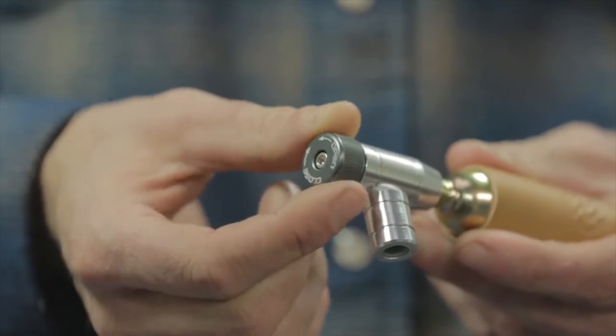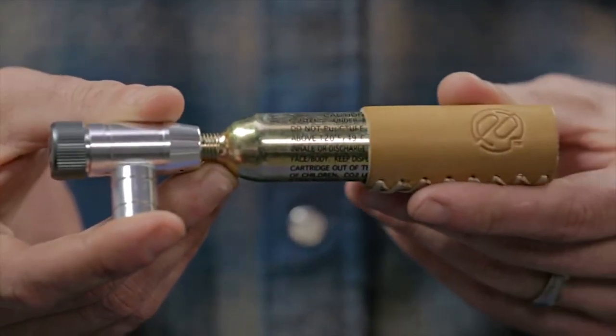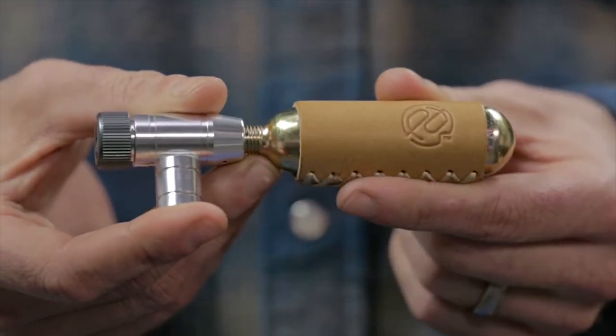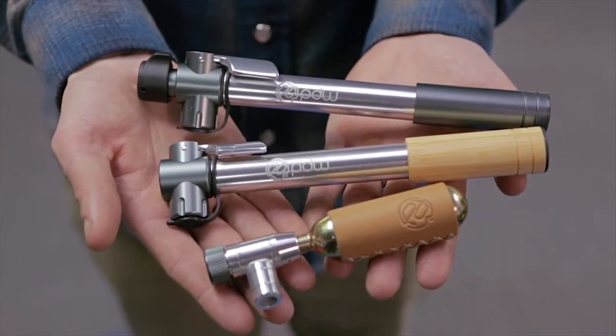When starting to inflate your tire, you can put just a little bit of air inside to get the tire seated and then go the rest of the way — there's no one-shot deal. Because CO2 cartridges get extremely cold when you discharge CO2 into your tube, we offer the Shiny Object with or without a leather insulation sleeve. It's a great product — really simple, and a lot better than walking home. It's another pump in the PDW inflation line that we're very proud of.